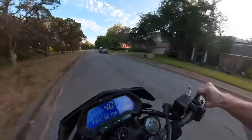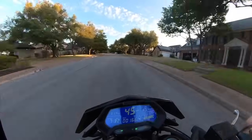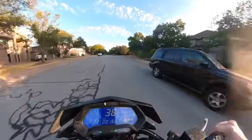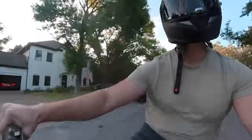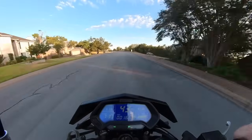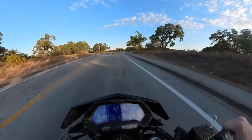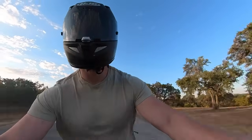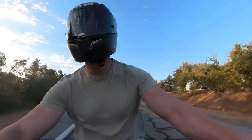Here we are riding the electric KLX 250. This bike is a whole lot of fun. You get a lot of torque, a lot of pickup, especially at the mid-range. I've ridden this bike a bunch of times already and made a lot of adjustments to the controller. It performs well as far as I can tell. The biggest downside is the programming — it's either buggy or the versions they have don't allow changes in certain settings. I got rid of most of the field weakening at higher speeds, so the top speed here is without field weakening, but I do get a lot of pickup at that mid-range.